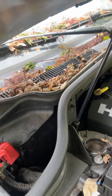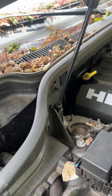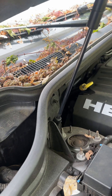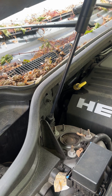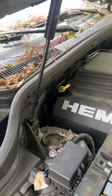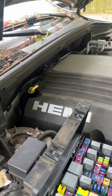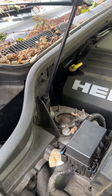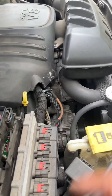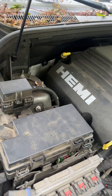The battery provides all of the power for the car and is going to be about 12.5 to 12.6 volts. You need to have it charged above that to keep it running correctly. When you turn on the headlights, air conditioning — whatever — that's called an electrical load, and the voltage regulator inside here will adjust itself.